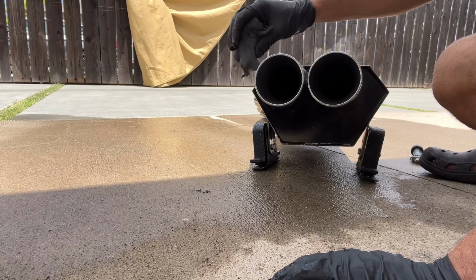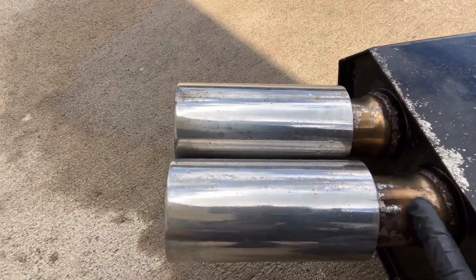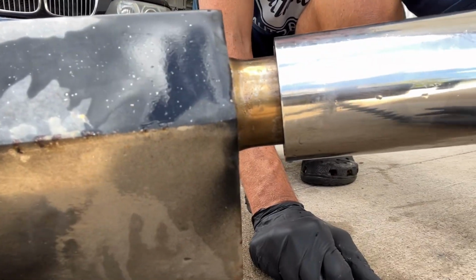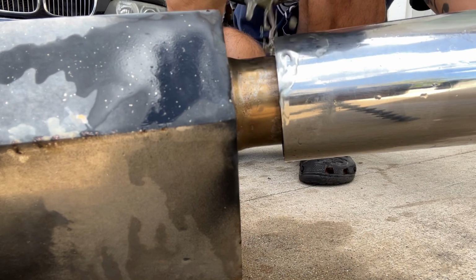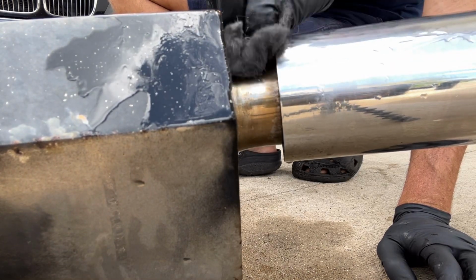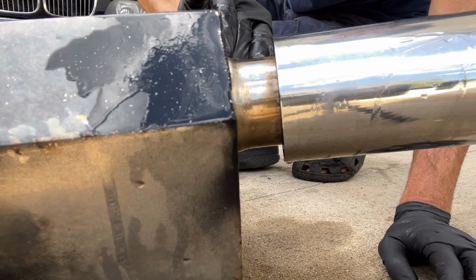Okay, so the steel wool alone is having a hard time removing this varnish here between the pipe and the muffler. I'm gonna try to see if the Ospho can help that. I want you guys to see this if you can without looking at my shorts. Okay, here we go. Ospho on the steel wool again. It does work. Believe that? I was rubbing that with steel wool and scrubbing it on, honestly, and yeah, it literally just melts it off. So it does work.